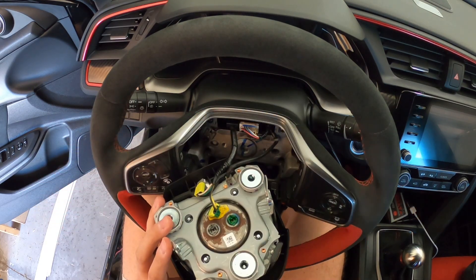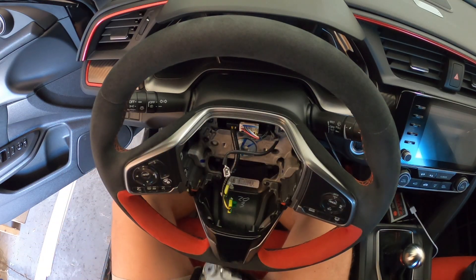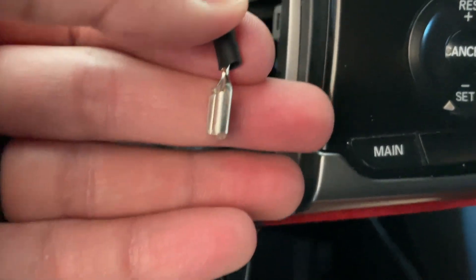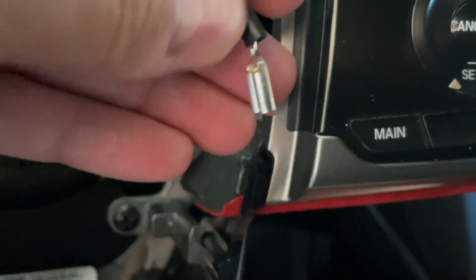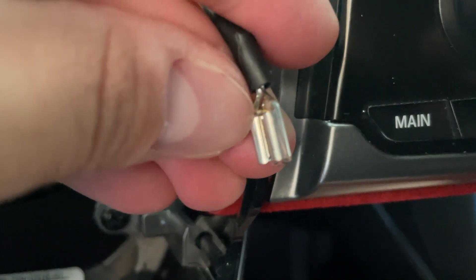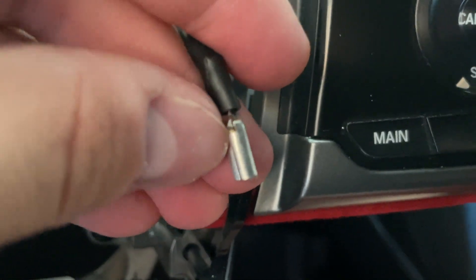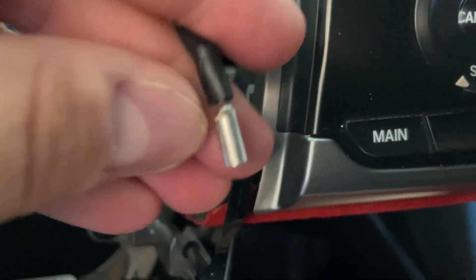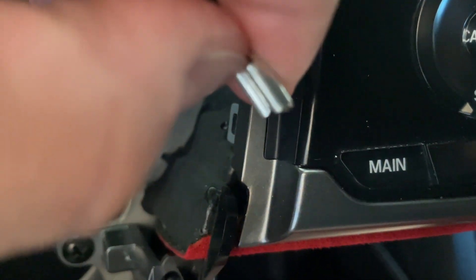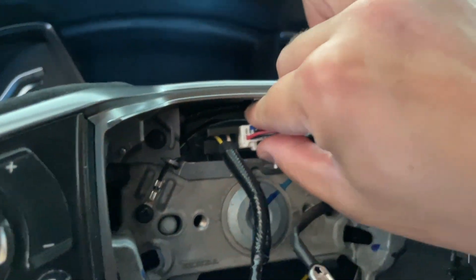Super important thing with this ground wire — I've actually spent like five minutes trying to get that off. It's gonna be plugged in facing down like this. There is a little lever right there, and if you push on that you're gonna hear it release and then you'll be able to slide it right off. So instead of trying to pull it out with brute force, you gotta get your thumb in here and pry that thing upwards.